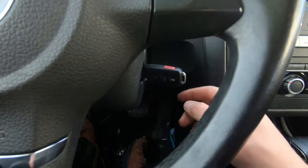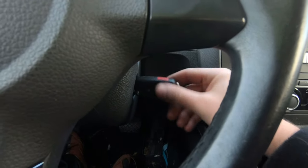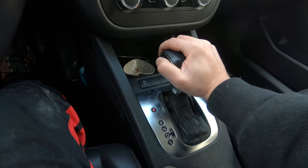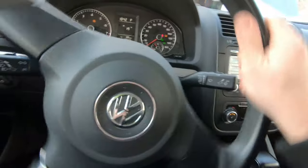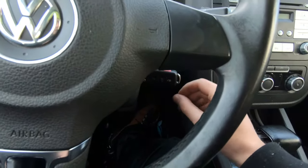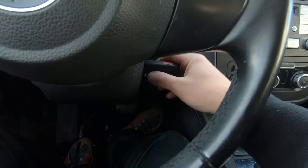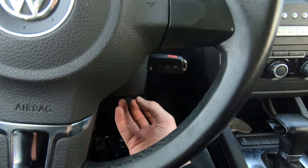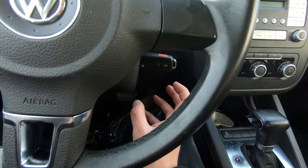There are a few tricks you can try to remove the key so your vehicle turns off. You can try flicking the key off and on, wiggling the key back and forth, and pushing it in and out while trying to turn it. You may want to put the vehicle in drive, slam it into park, and make sure the lock is engaged. Try turning your steering wheel left and right a few times as you turn the key — keep shimmying the steering wheel and the key. It's really random when the key will come off; it depends on where the blockage is in the ignition solenoid.